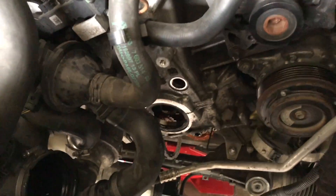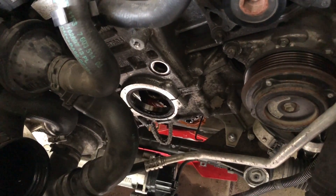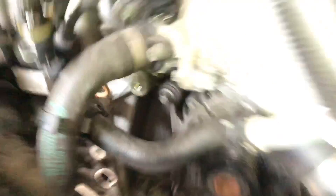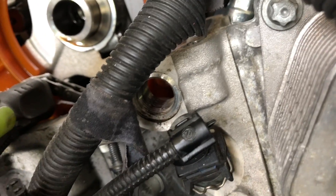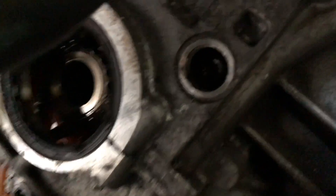It's the next day, I'm working on the car again. As you can see, I have removed the hub — pulled it out from the crankshaft. You put a couple screws in and just pull on it and it should come right out. There's a sprocket in there that normally goes onto here, so you kind of need to wiggle a little bit. I have also taken out these plugs, these access holes — you take the plugs out in order to access those bearings or screws in order to take this plastic part out.